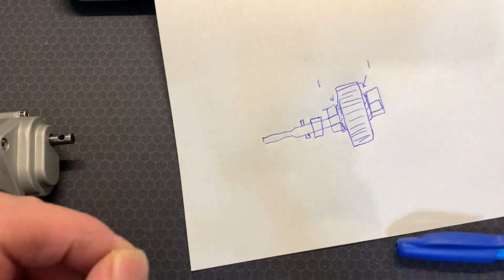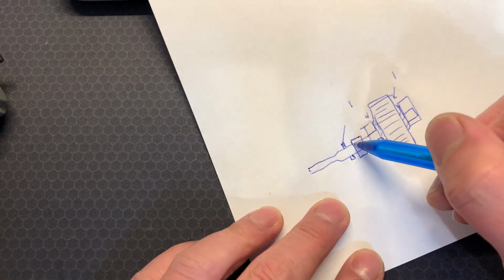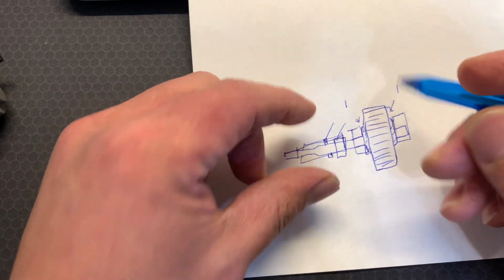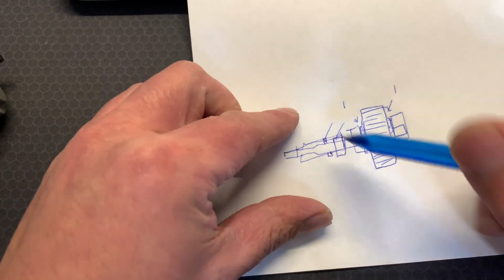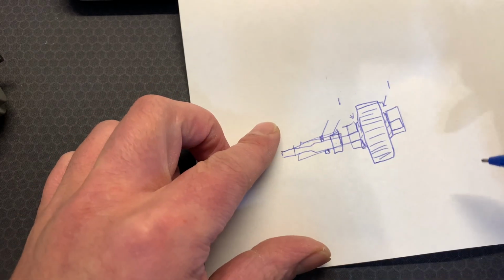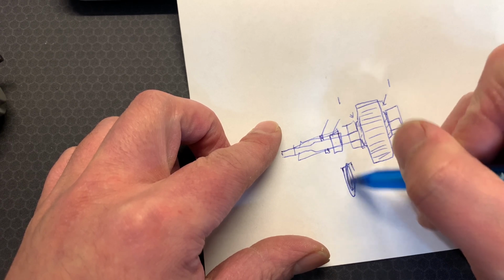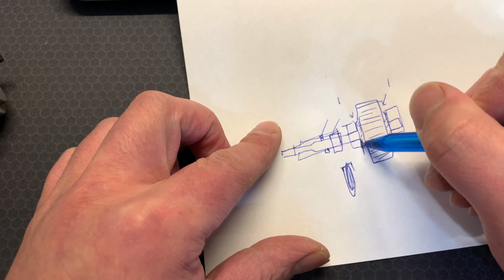What I did was I took my drill and, after uninstalling the pin and the bearing, I wrapped this shaft here in some paper, very tightly wound around so it becomes quite thick, and I put my electric drill over it and tightened it down so it clamped down here without damaging the shaft. So once I turn my drill on, this would spin. I then placed a piece of sanding paper, folded many times, and all I did was put it here while this was spinning, and that would take this part down here.